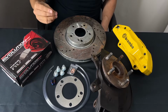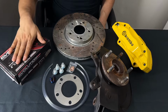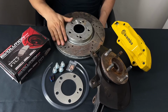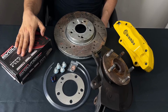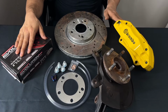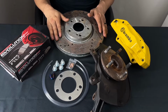Like I said, in the description we have there, you can order a complete kit, or you can order just the calipers itself. But what we're going to cover is the rotors and the brake pads. Our rotors and brake pads come from the 07 to 08 Acura TL. So when you need a replacement for rotors and pads, that's the year that you will be replacing the pads and rotors from. You can use any brand as long as they're to the same spec. That's what you want, now that you're going to have a 4-piston caliper kit on your car. You can go with any brand you like, but they must be the same spec.